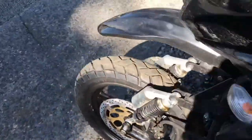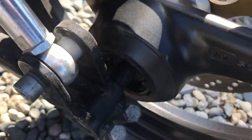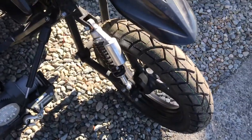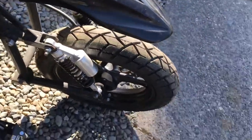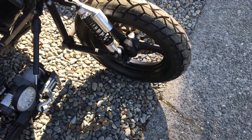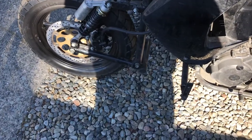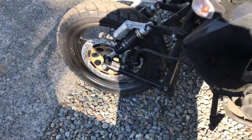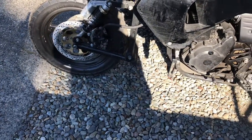One last thing: the KLR speedometer does not fit on the GS wheel, and the GS speedometer runs a totally different cable than the KLR. I can't find a long enough GS500 speedometer cable, so as of right now I do not have a speedometer hooked to the bike. What I use is a speedometer app on my iPhone that carries over the odometer, so I can use that for my fuel and just reset it when I fuel up — works out really good, and it was like $4 for the app.